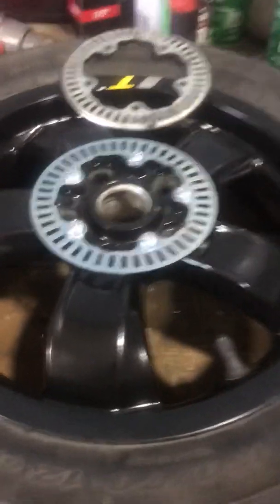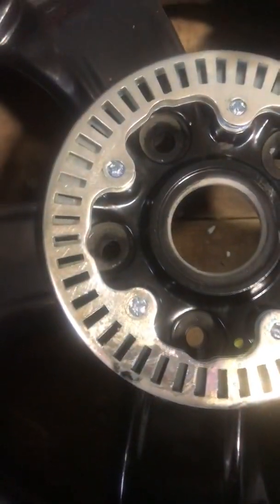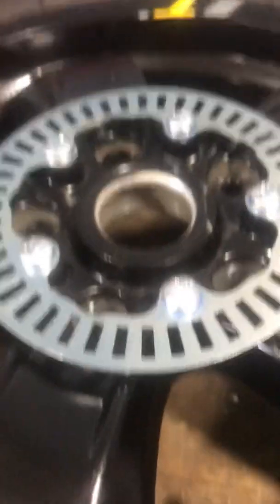The difference I noticed in the tone wheels — you can see the spacing is completely different. There are fewer teeth, so I guess that's going to report a slower speed to the ECU. From there, we should be able to get a higher top speed and a truer, more accurate speedometer reading. I'll let you know after I calibrate it and see how that goes.